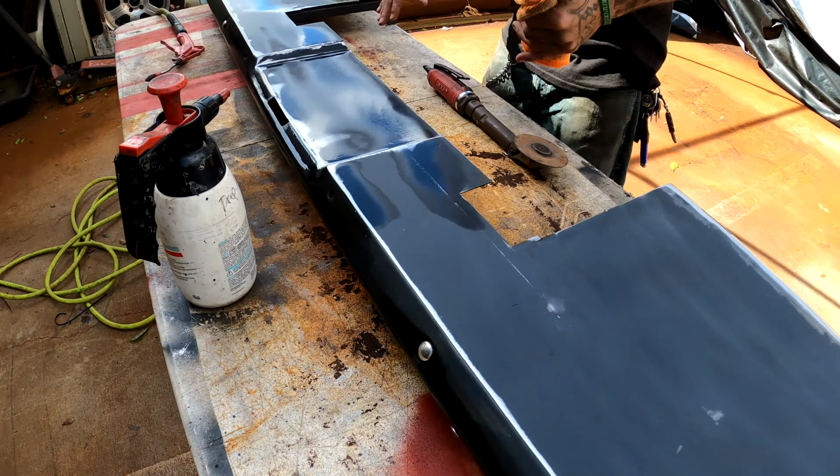Okay, so this is a full wraparound Camaro rear bumper for a '67. What we did is we flipped it upside down. We built the entire platform out of sheet metal, built the entire frame for the supports under it. Then we took a secondary Camaro bumper and we split it and sectioned it so we could put our extensions on the sides. And then we added a third one, which we just bought. It was a complete one, and I'm using about half of each side, and it'll make the wraparound to the back that goes all the way to the chassis.